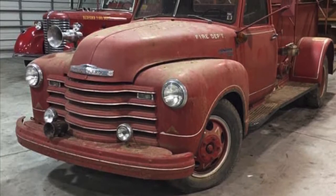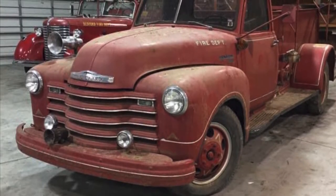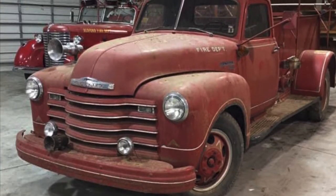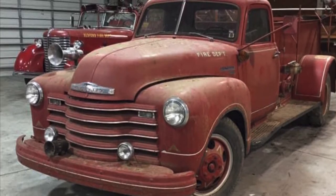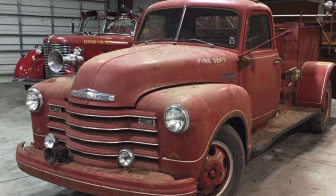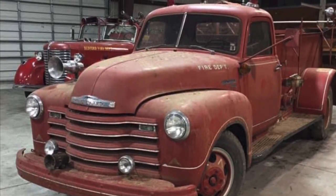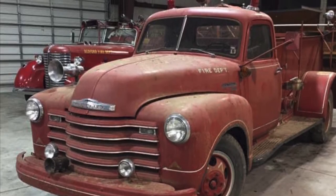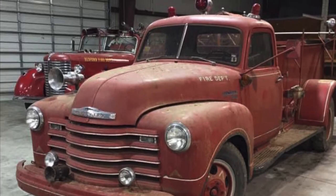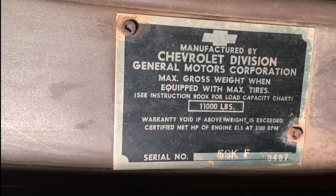The main issue we knew about with the truck prior to purchase was that when the truck was donated to the Vintage Fire Museum, the rear axles, the tires, nothing would turn. They were seized up, locked up. The story was the truck was driven into storage several years prior, but stored with the parking brake set in the barn. So the basic assumption, including myself, was a pretty simple answer: the shoes were stuck to the drums and seized up, not allowing things to turn.